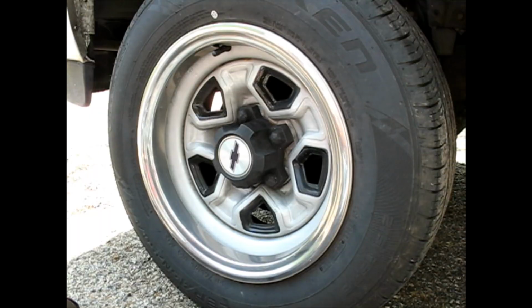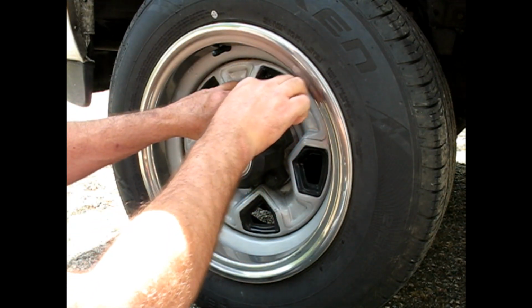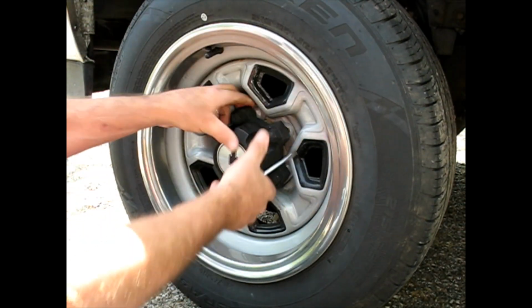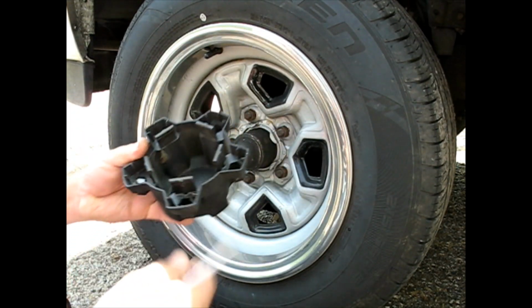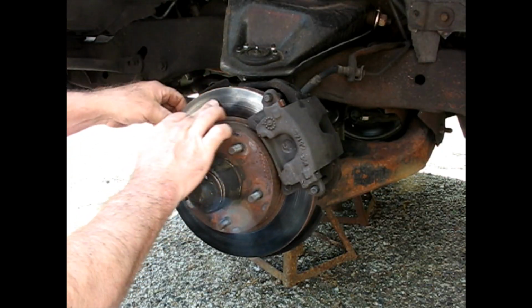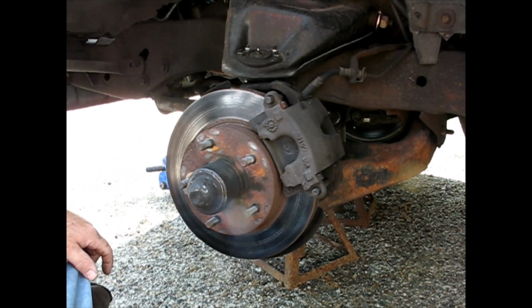Let's get started. Be very careful with these clips on these hubcaps because they're plastic and they're very old and they get brittle. Intact. And oh boy, is that thing glazed up. That's what happens when it's all running on one, potentially. Got you zoomed in on the driver's side brake hose there. The outer hose is already worn through, so I don't mind replacing them.